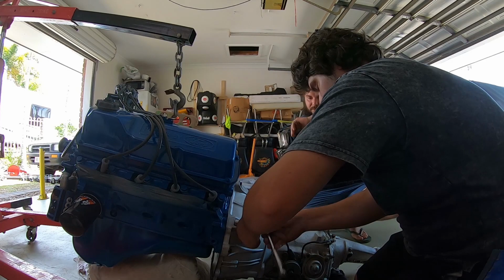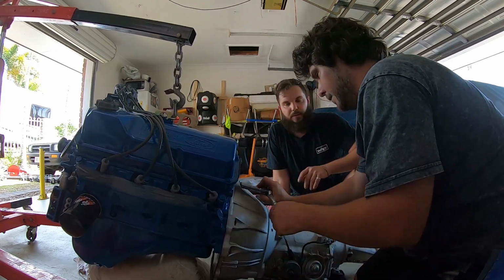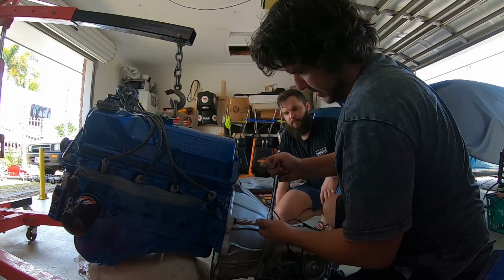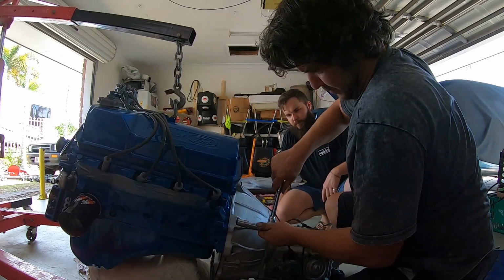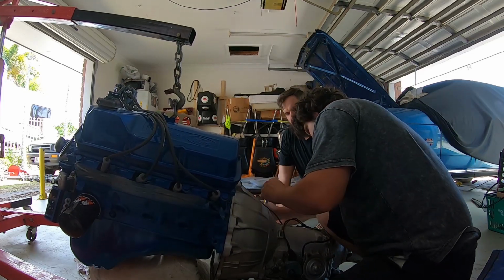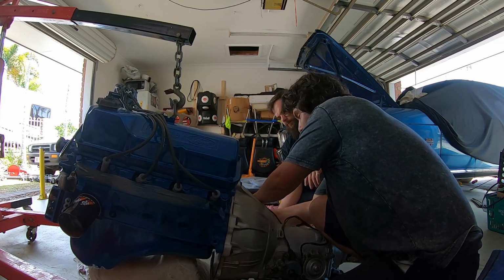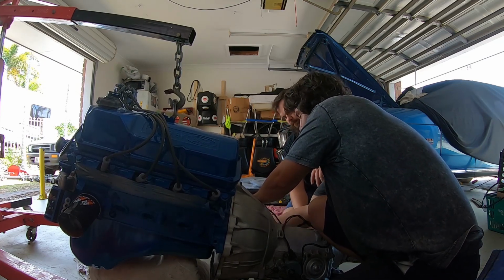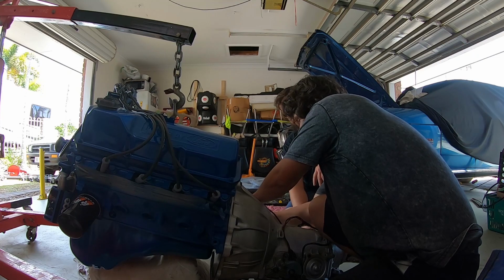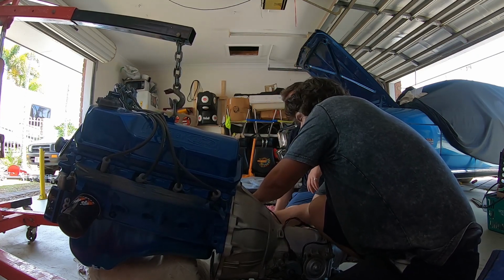See, guys, successful. This is definitely not something to attempt by yourself. I don't think you can do it. Definitely two people for this. Just by finger, guys. We're not going all the way because you've got to check that the engine turns over before you do these up too tight, or you can easily bust the pump, even now at this stage, after checking everything. But if it's slipped or moved, in theory your dowel should be lined up.